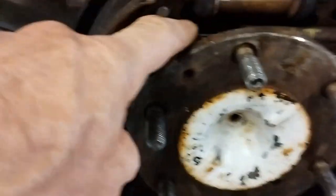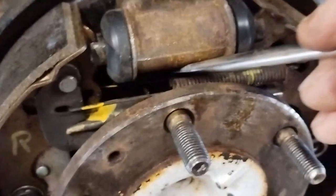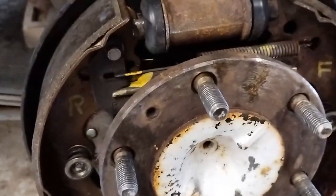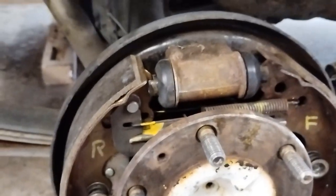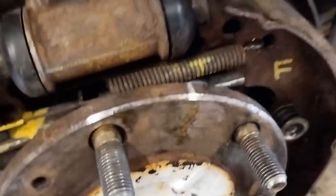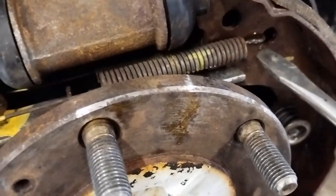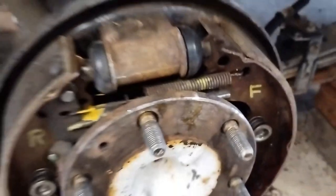Okay, so you've got the long arms on the left-hand side or toward the back of the car. You've got the springs lining up. Both the rear and front springs are at the same point. If I can find a torch, I might be able to show that a bit better. So we can now see the rear and front top springs, the long arms on this side, and the front side, the tangs use the same hole. So that's the bottom of the inside tang down the bottom there, and that's the top spring.